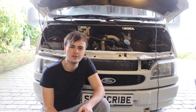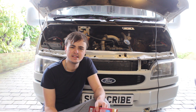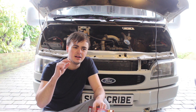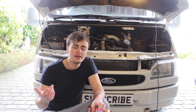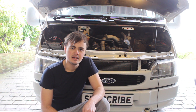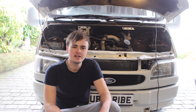It's just not really something that people do, but it should be done. Reasons you might want to check and adjust your valve clearances: if your engine sounds a bit tappity, over time the valve clearances might get slightly larger and you get a tappity sound from the engine, so this might help quieten that down. It's also something you should do to make sure your engine is running at its optimum performance.